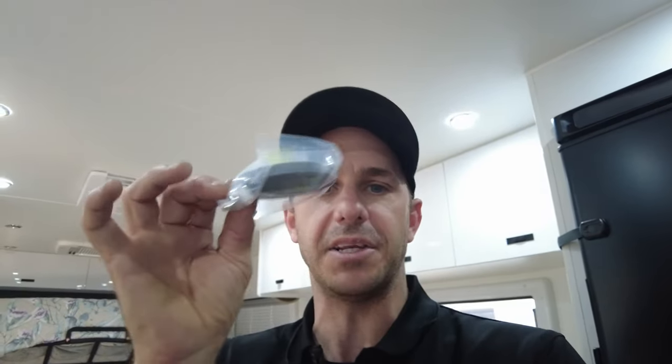It's a very secure way to have these sensors for your water tanks underneath your caravan. And I know you're thinking, stone smashing it. Put it out of the line of fire. You can see where all your stone chips are. If you've got a new van and you're concerned about that, just get a bit of foam from Clark Rubber or some sort of padding to put over it. They're very thin, only 8 mil thick, so it's not going to protrude very low. They are IP rated too, so they can take a bit of ingress.